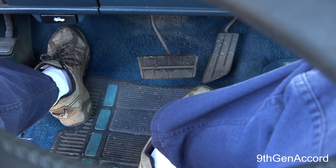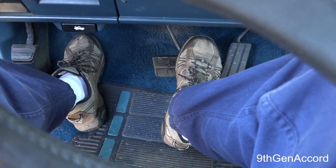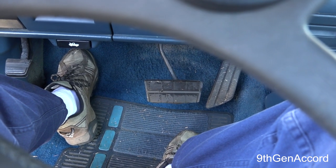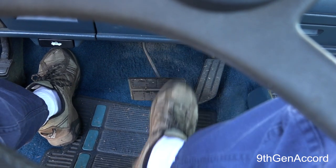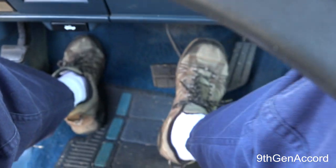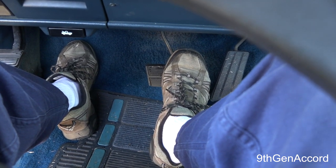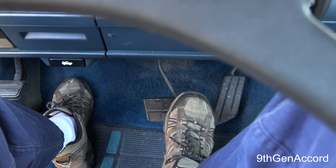Just a final update on disabling the rear anti-lock and taking the dump valve out of the way. The pedal is 99% acceptable now — I do need to do a little more bleeding, and I did get a lot of air out of the rear brakes. But this is the way a pedal is supposed to feel in a Chevy truck without the anti-lock brakes and without the dump valve in there. The pedal no longer goes all the way to the floor — it's got a little travel, a nice firm feel, and it's not sinking anymore.